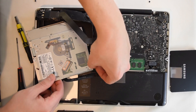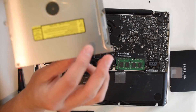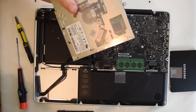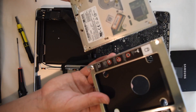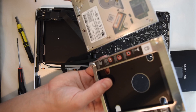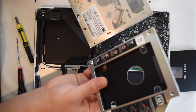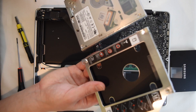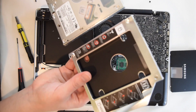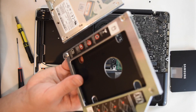Carefully remove it. So you have the optical drive here, which we'll be replacing with this converter that the hard drive will sit in. I got this from Amazon for only about $8 — link down below in the description. From this point, I'll show you which kind of hard drive I'm going to use and how I get it into this converter.